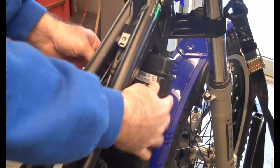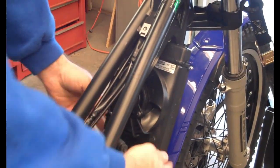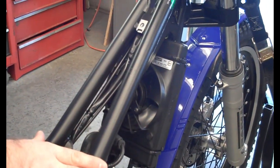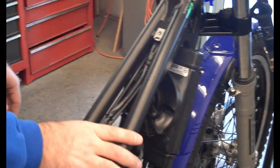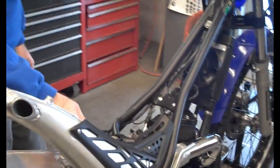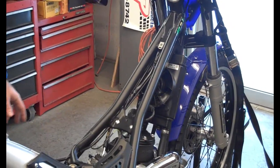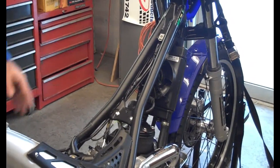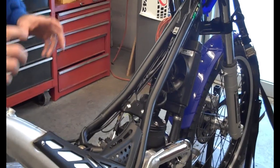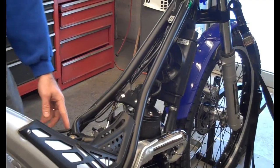In your radiator, there's just 1 screw, but it's rubber mounted, and the bottom has 2 rubber grommets that pop right out, so it's all very flexible. You can see how narrow the new frame is here. All new tubular frame. Very strong design again. The way the motor's mounted in the frame is all new. The way the bolts go in, the way they're threaded, the way the nuts are, so it's easy to tighten up all the bolts on the motor mounts this year. All new short gear shifter, all new swing arm.